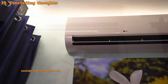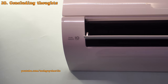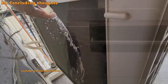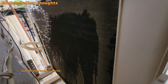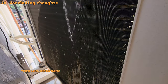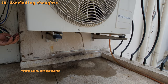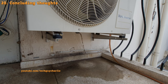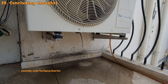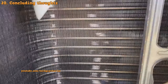You also get five years warranty on the inverter PCB and a 10-year warranty on the compressor, which also includes gas recharging. From my experience, as long as you maintain your air conditioner by regularly cleaning the condenser coils, you are never going to encounter any problems with the compressor or the PCB. I clean mine every six months — you can see how dirty these things get — using just plain water, no soap or special chemicals. Regular maintenance goes a long way and will definitely extend the overall lifespan of your air conditioner.